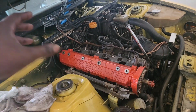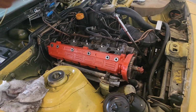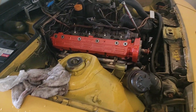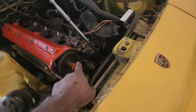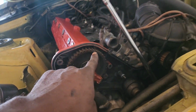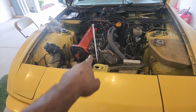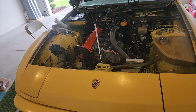And you gotta just slowly start working it down from the corners, in and out, back around, and then eventually it sits down because it is on a spring. It is under that. So the most important thing is that we stayed at our timing marks here, and we're at top dead center still, which I continue to verify there. And so yeah, we're making some good progress here.